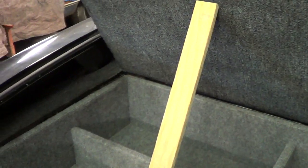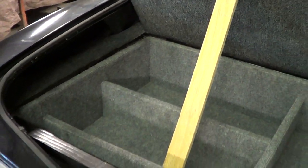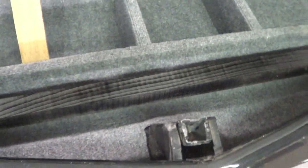And there's just places back there I can't get to with a torch, so it looks kind of shabby — which is good because the original car is that way. This here is a 2x2 that we paint black and wedge down in there. You could probably put a screw or something in that. The reason for that is your taillights are down here, so you can move this if you need to get your taillights out. It's pretty sturdy, but there might be a better way to anchor that down. I always look at access to taillights and stuff like that.